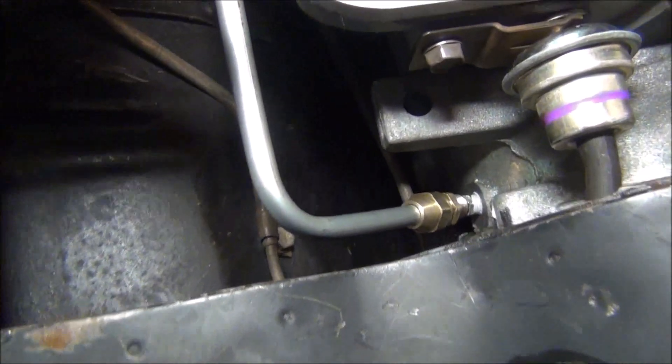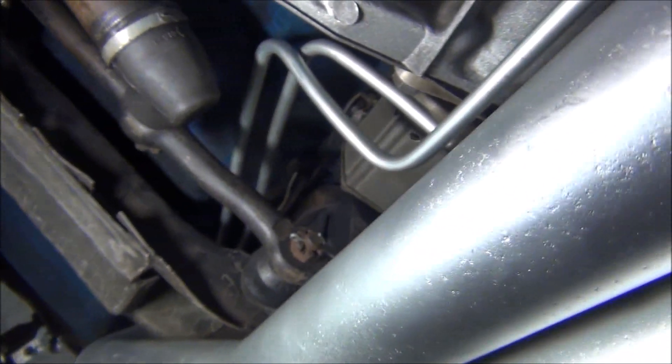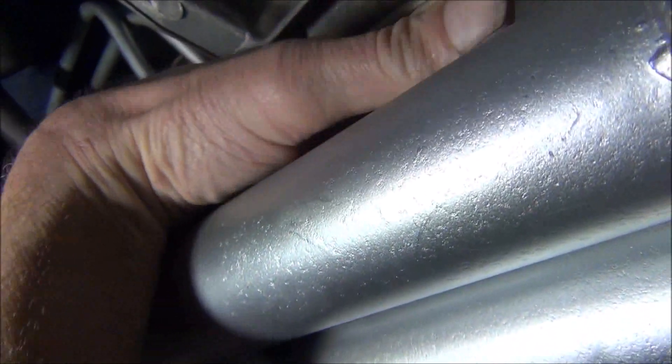I know it's hard to see — just showing you what it all looks like underneath. It turned out pretty good, I think. Not as perfect as you always visualize when you want to custom make your transmission lines or fuel lines or whatever. It's really hard to bend that hard 3/8 stuff. A holder right here will make that look a little better. That one's a little closer to the header than I want it to be. I am going to order some thermal wrap to protect this from heat, and I may wrap it around the line too.